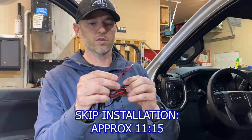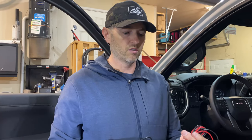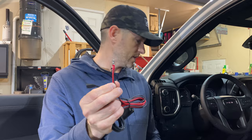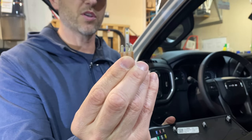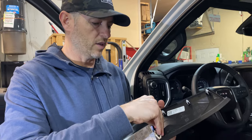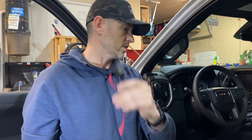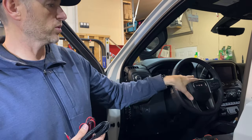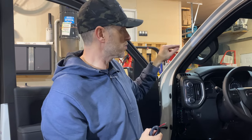We have our hardwire kit: a ground and a positive terminal to connect to a 12-volt or 24-volt power source — interesting for truck drivers. However, GM threw a problem our way: all the fuses in the cabin fuse panel are special tri-prong fuses, and the wire taps included only work with two-prong slots. So we can't use those. Instead, we're going to pop out the 12-volt cigarette lighter adapter in the dashboard and tap into that wire source, then run the wires through behind the dashboard.